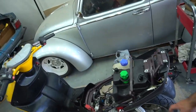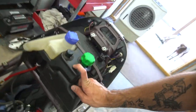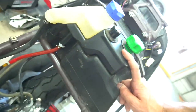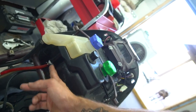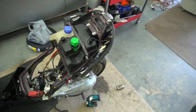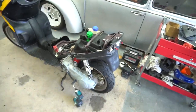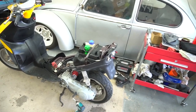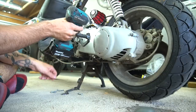I didn't want to at first and I wanted to run the Y cable to do the oil pump situation, but I cannot get this oil tank to work and it's impossible to find parts for this. I think there's a crack in this oil tank at the bottom because it does not want to seal. So I'm going to take off this side case and take a look at this oil pump. I know this oil pump is belt driven, but I'm probably just going to zip tie it open and run pre-mix and block off all the lines like you would do with the Hondas.